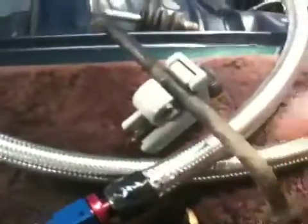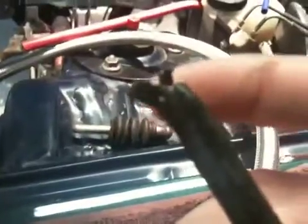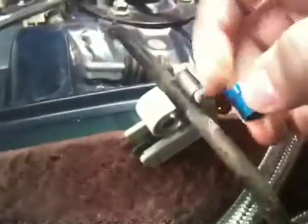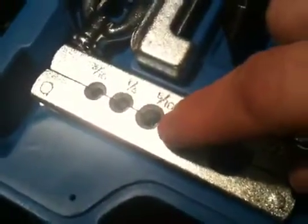Imagine that this is the piece of the fuel line running underneath the car. There's a little tool with a blade in there that lets you cut the fuel line nice and evenly. You cut the fuel line, then put both the nut and sleeve on to the line, and then you use a flaring tool. In our case it's 5/16ths, so you put the line in there.